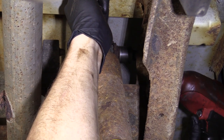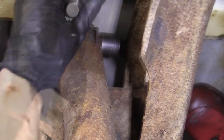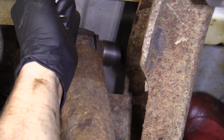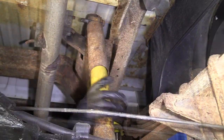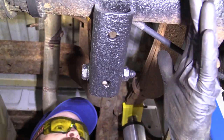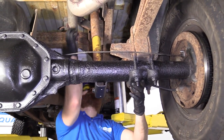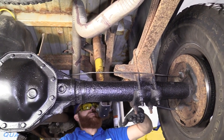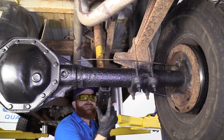You can try to use a ratchet if that's what you have. Safety glasses. Here we go. Feels like it's coming loose. There we are — there's our nut. We'll take that out in a minute, leave it right as it is. We'll get this nut off of here, and then we're going to grab a pole jack. If you have a pole jack or jack stand — if you're working on the ground — or even a ratchet strap up to the frame, just something to hold the differential where it is, because it's going to want to drop down. So let's take this nut off.